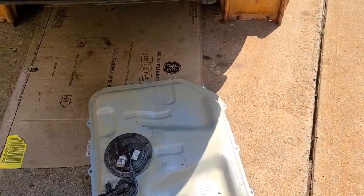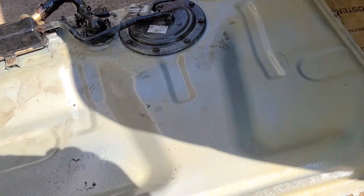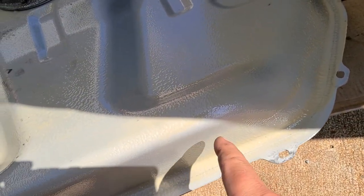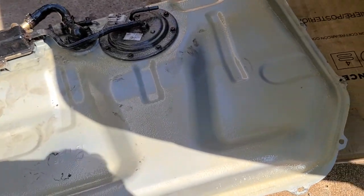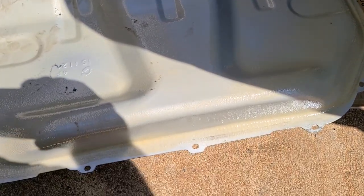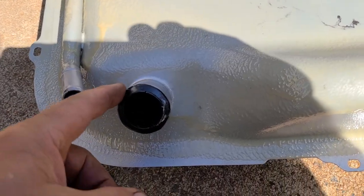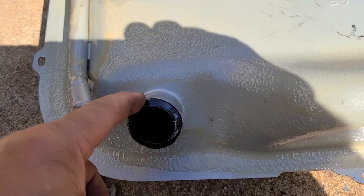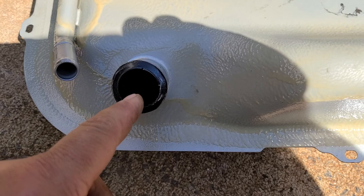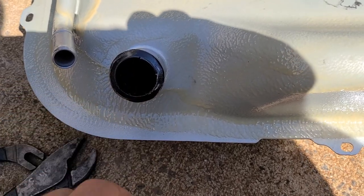What we've encountered with little Susie was the gas tank was bad. We had a spot on the old tank right here in the front that had a blister in it and it was weeping gas out - that hole was weeping gas which also leaks out pressure. The other thing I want to tell you - you've got what's in these tanks. I had to put this spring valve in. What that's for is if your vehicle flips over, your gas won't just pour all over - it's a safety device.